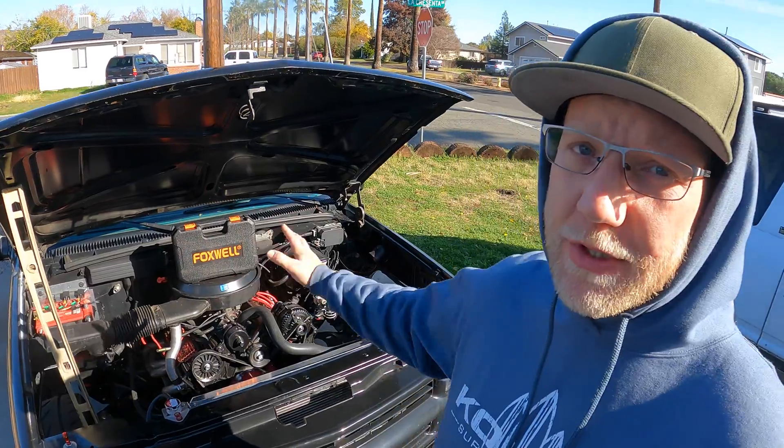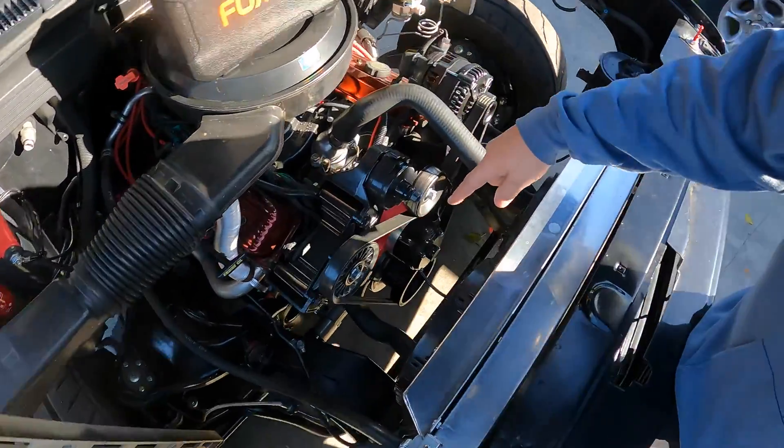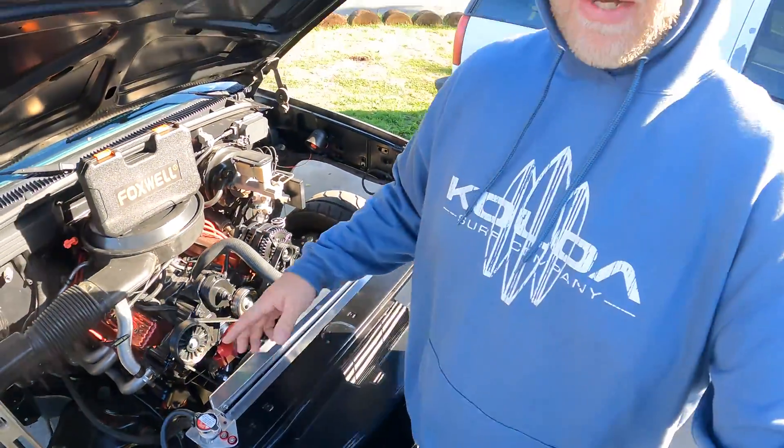Hey everybody, Alan here. Welcome back to the Gibson Garage Speed Shop YouTube channel and thank you for tuning in. Today we're going to be doing an unboxing slash review of this Foxwell battery analyzer. The company reached out to me at the perfect time as I'm doing this alternator video. I have a factory 105 amp GM alternator and it was not designed to do anything but the AC, the blower motor, and a radio. I've got an electric water pump and electric fans on here and I've been having an issue at idle with that water pump on — it kind of takes away from the electrical power I need just to run the car.